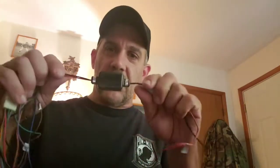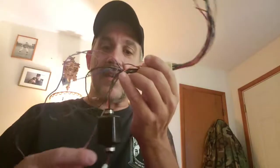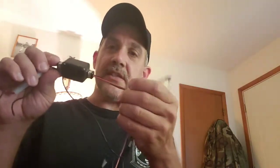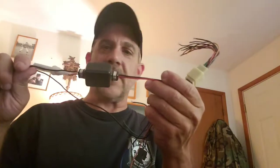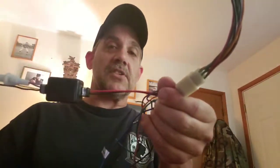On a lot of those old radios like you heard, there was some humming. That was my power unit - the battery, the power source, along with the alternator will create a humming and a resonance throughout the stereo system. That was solved with one of these little boxes - the power goes through there and it filters all the humming out before it goes into your radio and you get a good crisp sound. If you have humming you can actually buy one of these. Both the power and the negative go through it; it filters all the excess electrical noise out and doesn't run it back through your speakers.